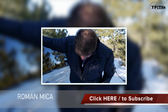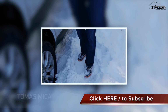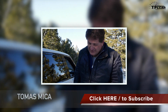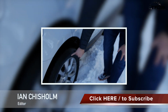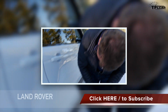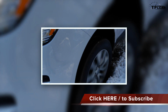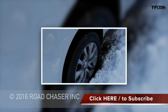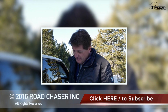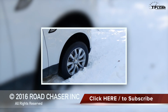Now there's probably about a foot of snow that's kind of crushed. But the problem is not with the Range Rover, it's with the tires. They do say mud and snow on them, but man, these Goodyear Eagle F1s are anything but mud and snow. So while this Range Rover has terrain management, it can jack itself up so it's not high centered. It can't get past the fact that these tires are just no good in the snow. So we are stuck.